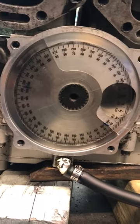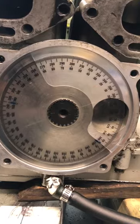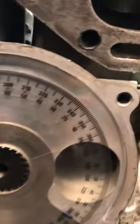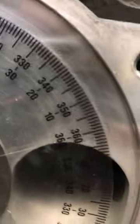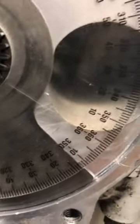I recommend this little $10 degree wheel — put a couple of marks on it before you start working. We set it at 360 degrees, and I made a little line at the top of the port right here. We go to the bottom and we read 65, which is good.